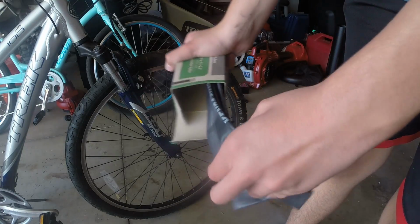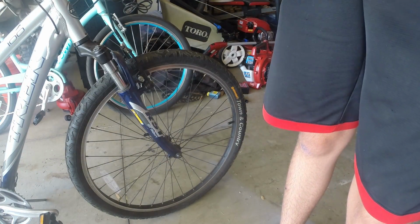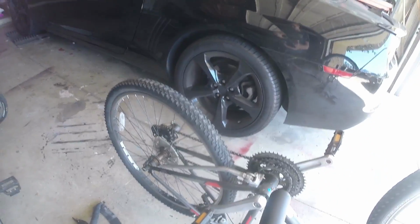So I'm going to try to take the new inner tube out of the box and see if I can get that to pump. If I can't, well then it's not going to be good news for the pump. Good news. I got this pump to pump some air into this tube. So looking like the pump is not totally screwed. It might just be the tube. For some reason it just doesn't want to pump any air in there. Maybe I'm not getting the pump on the valve right or something, I don't know. But either way, I'm almost certain that tube has a hole in it somewhere, so I may as well not be lazy and actually change it out, and it'll be less of a hassle for the next owner.